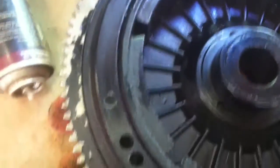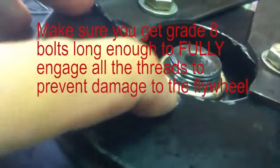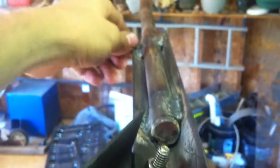I'll show you the tool I made to hold the flywheel. Here's the bracket I made so I could torque the flywheel nut. It's just two pieces of angle iron — actually it's a bed frame — with 5/16ths holes drilled in it, and then a 5/16ths hole drilled here with the bolt. All grade 8 — these are grade 8 5/16ths fine thread because they have to be to screw into the flywheel. It might be different for your motor. This is an '86 Evinrude 150, and I just welded this bar on it so I can get some extra leverage.